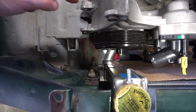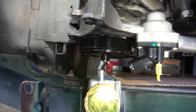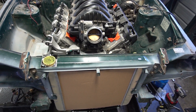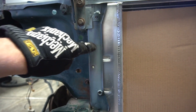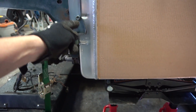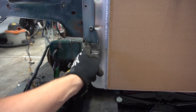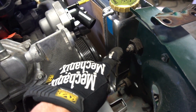Scratch that idea — if I did that I'd create a piece that comes over and ties here and I'd never get it past the frame rail on the bottom, so the radiator would never come out of the car. Due to that, I decided I'm going to come in and make my mounts right here, bolting through from the outside with a nut on the inside. I'll do another one here with maybe a little rubber washer to help it float, and the spacers I made get welded to the radiator right on the inside. The mounts will be hidden inside instead of using those factory mounts and making a big mount that ties over to them.